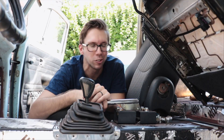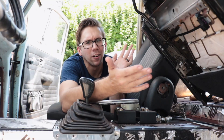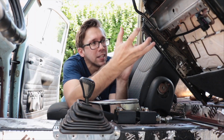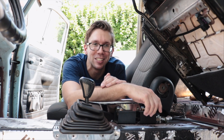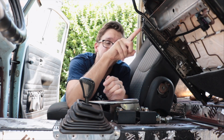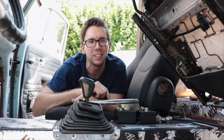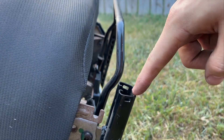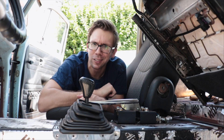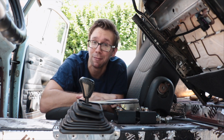When I took my wife on a junkyard seat swap finding adventure — the romance is clearly not dead in our house — I was looking for a seat that was pretty small, narrow, and had some rails without a weird attachment on the front. In true fashion, the seat she liked had a weird thingy on the front. I went out and ground that off so I could slide some bolts directly through it and mount it the old school way. Before pulling the seats out, I made sure there was enough space to fit the thickness of a bolt head between the inner and outer rail so it would still slide. Never made that mistake four or five dozen times.